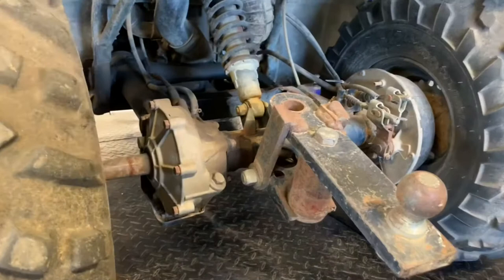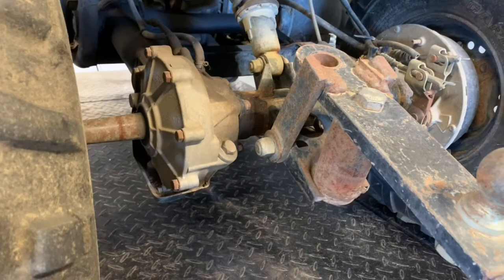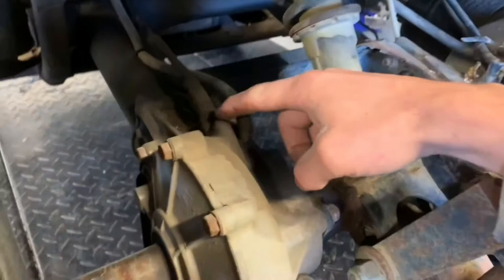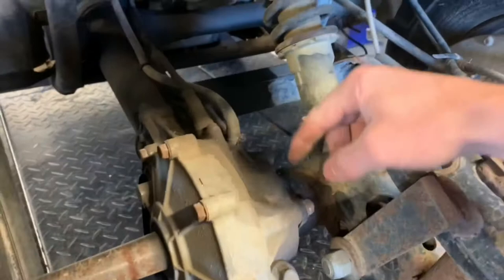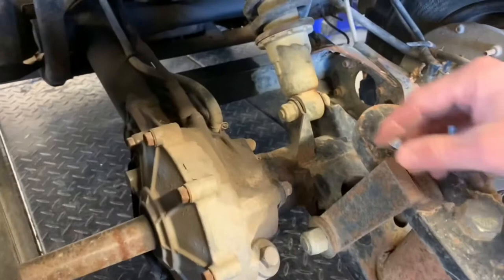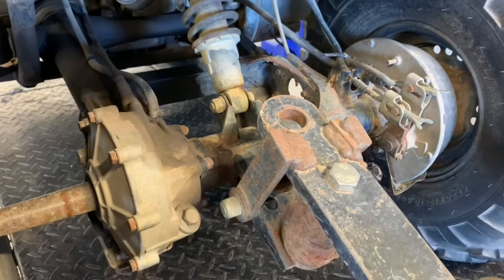On the front and rear differentials on these machines, you can use the same oil — just about any 80W-90 differential gear case oil. You want something thick in there; don't use regular engine oil, it's not thick enough and doesn't have the right additives. One common problem on this machine is the speedometer cable runs into the differential and often starts leaking, causing the differential to run low on oil and creating serious problems. Nine times out of ten when I get a Prairie 300 or 400 in, there's oil residue around that housing. Inspect that when changing oil and anytime you go out for a ride.